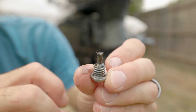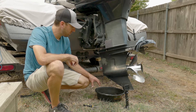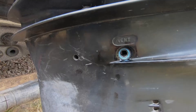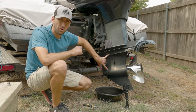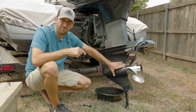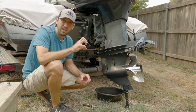I'm not noticing any water in my oil, so that's good — we don't have to replace any seals, but I'll show you how to do that just in case. If you see any milkiness in it, that's water. Water can get into your lower unit oil through seals or rings on each plug — if those seals are cracked or bad, water is going to get in. Another place, which is more common, is through your prop. If you've got a lot of fishing line wrapped around your prop, that cuts into that seal and can let water leak into your lower unit oil. So it's a good thing to take the prop off when doing this, check it for fishing line, check that seal, and replace it if need be.